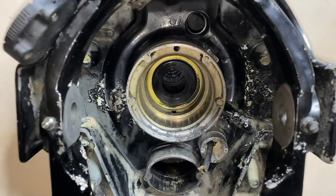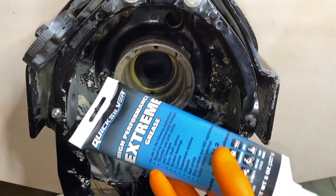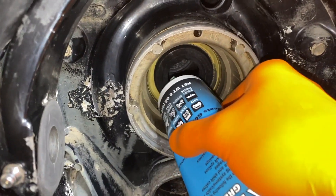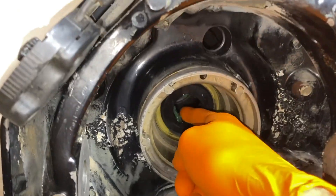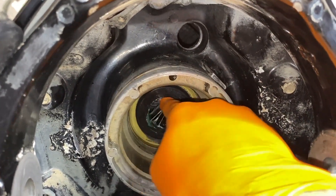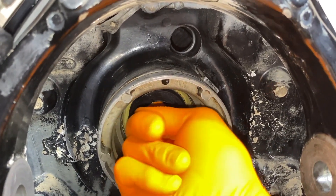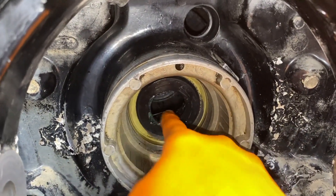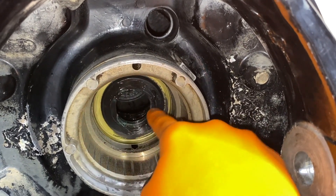Right now it's in the freezer, which helps it shrink just ever so slightly in diameter. What I'll do first is apply some Quicksilver high performance extreme grease on that rubber seal to lubricate it just a little bit, because your U-joint shaft goes through here and spins at an incredibly high speed. So I want the back side and front side of this rubber seal lubricated. It's not going to have that large amount or buildup of grease that it previously had.